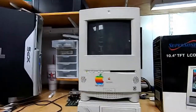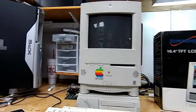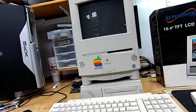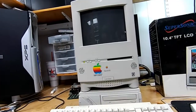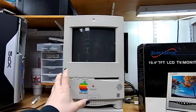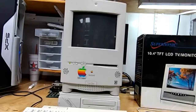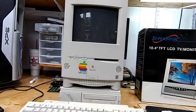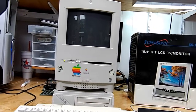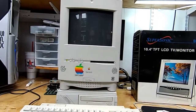Now, the machine is equipped with a Motorola 040, not an LC. It's got a full-blown Motorola in it, and 132 megs of RAM. One of them is a 128 meg 72-pin SIMM upgrade. So when you're in Motorola mode, the 040 actually sees all the memory, and it takes a little while to count it all. When you first turn it on with the Motorola 040 activated, it's going to take a minute. Then theoretically it should light up and run.